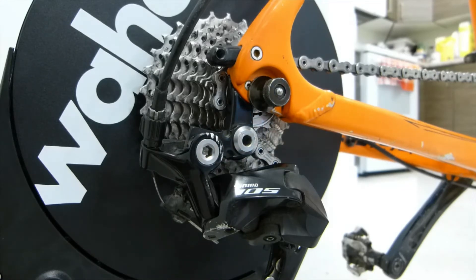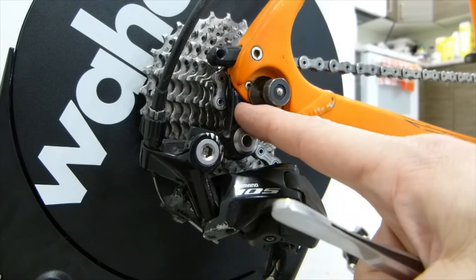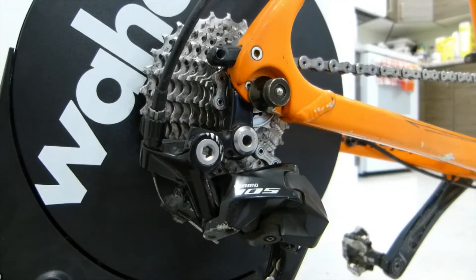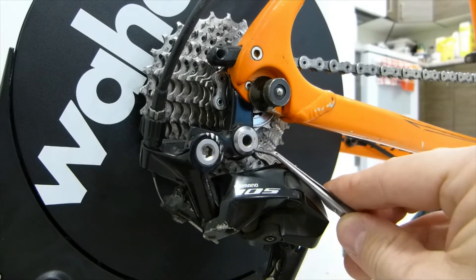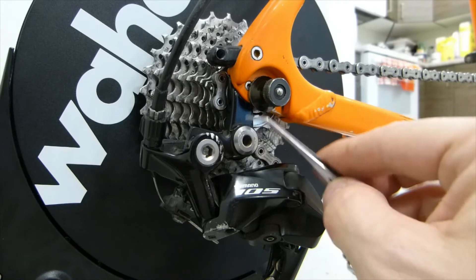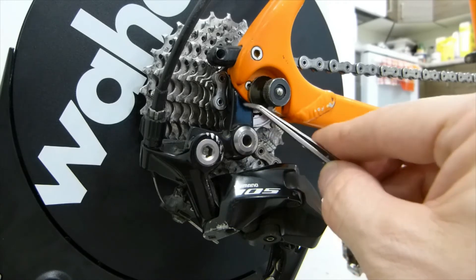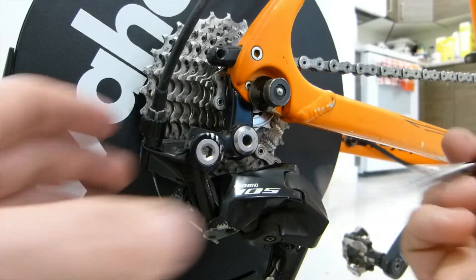Upper and lower limit screws will be somewhere on your derailleur on any multi-speed bicycle with a derailleur. Let's have a look at straightness with the same piece of paper, and see how good this straightening turned out to be. I'm lining up the edge of the paper with the center line of the chain at the top of the sprocket, and at this point the edge of the paper should go through the center line of the chain at the bottom of the sprocket, as well as through the chain as it wraps the bottom of the tension pulley.